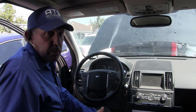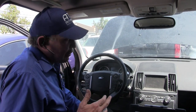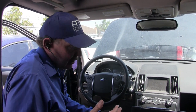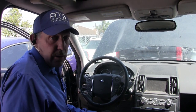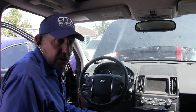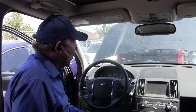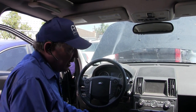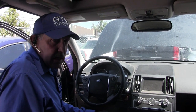This car was brought to this shop — it's another shop's car that they've just put a head on the engine, and the head hasn't run yet. When they got the head on, apparently the car is totally dead. They brought it over to this shop and now we're going to diagnose it to figure out where the problem is. Maybe the engine control module or the transmission module — that's my first thought. But I'm going to warn you guys, all of that's hearsay.